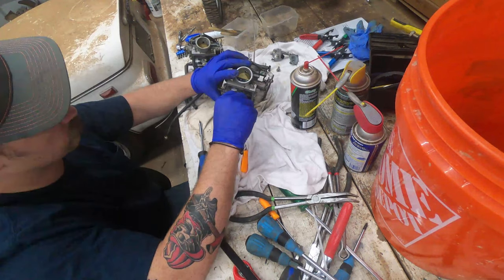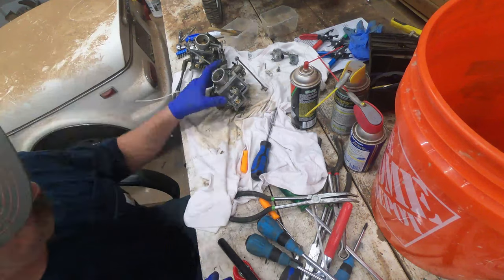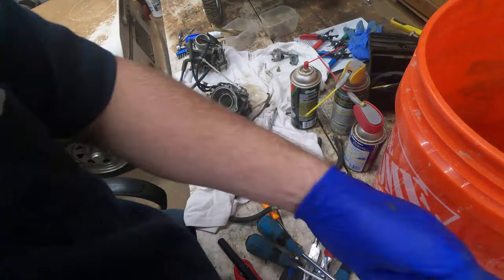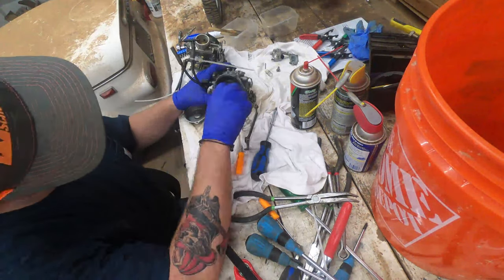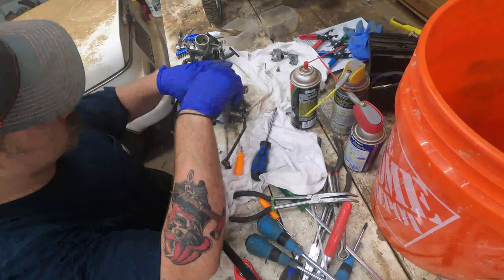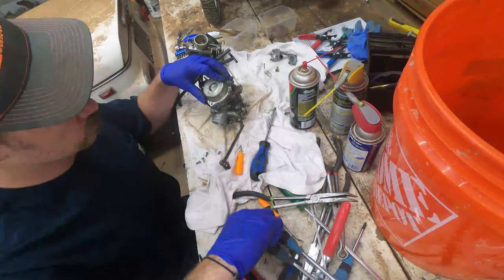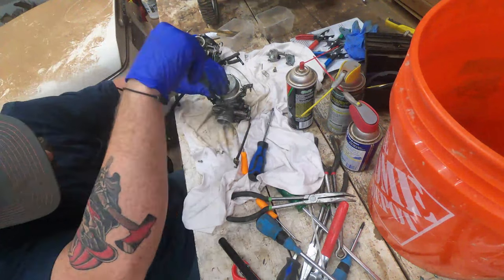Here I'm just installing jets. You need to keep your jets and everything separate — soak one carburetor with all its pieces in one bucket and the other carburetor with all its jets and screws in another. Honda's shop manual specifically wants you to keep the pieces separate.